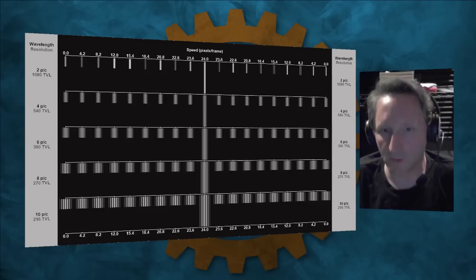And exactly. And there's other test discs that do have motion resolution. I think Japanese had a couple test discs, FPD, flat panel display. I remember the FPD display disc, which whenever I showed it to anybody, and I've used it a lot, they say, oh, where can I buy that? Well, I had no idea. I don't think you can. Well, on that disc, all their motion patterns are 1080i. So ours, we went the other direction. We went 1080p, at least for the motion resolution. But then we have a few other motion patterns that we give you in 24p, 30p, and 60i. So you can test how your display is doing in terms of motion resolution for basically any type of input signal that you're likely to get.